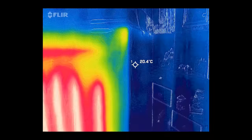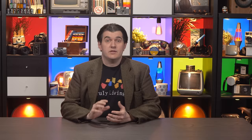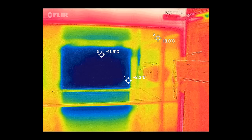At the end of this serpentine path of tubing, a metering device — most likely a simple capillary tube — restricts the flow of refrigerant, causing liquid refrigerant to bunch up at that spot. The point of that restriction is to create a pressure differential, and once refrigerant manages to make it past there, it finds itself in another long snake of a tube. As before, it goes up and down beneath the plastic skin of the fridge, but this time it's beneath the skin on the inside. This right here is the evaporator, and when the fridge runs it gets nice and cold, because in these tubes the pressure is low and the refrigerant wants to boil, or you might say evaporate.